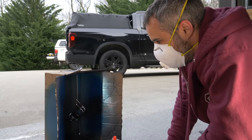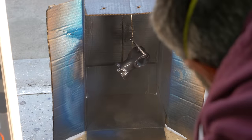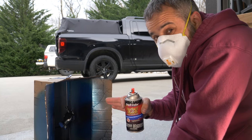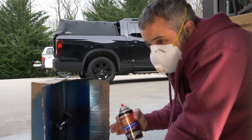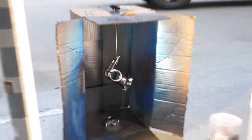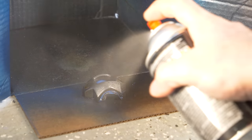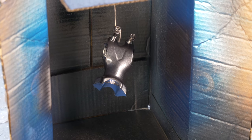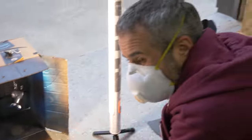Now we're really going to let this cure pretty nicely before we put the clear coat on, because as this is drying with the hardener in it, it actually off-gasses. If you put a clear coat over it too soon, those bubbles are going to come up into the clear coat and you're going to see them — you're going to have to sand it all down and redo it. The thing with clear coat is you want to lay it on really thick, but you don't want it to drip. That's the side I wet sanded and you can't see any of the dullness now that the clear coat's over it. As shiny as it looks now drying, that's what it's going to look like when it's totally cured.